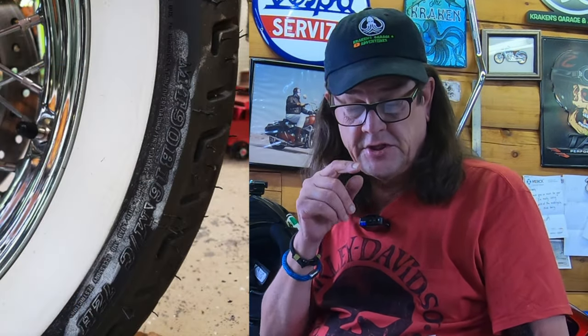Dunlops are on my Harley-Davidson Revival — I'm throwing a few pictures of my tires up on the screen. Bridgestone's break-in period guidance: tires should be ridden very cautiously for the first 100 miles in order for the tread surface to be scuffed in and work properly. Directly after new tires are mounted, sudden acceleration, maximum braking, or hard cornering must be avoided. This allows the rider to adjust to the feel and handling characteristics and for the new tire to achieve optimum grip level. Bridgestone did not say yes or no to using a release agent — they were very neutral in their reply.